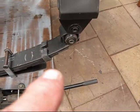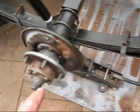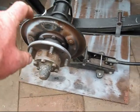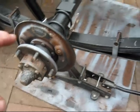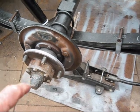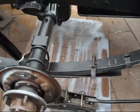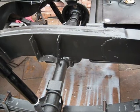I'm waiting for the shackle pins — for some unknown reason I haven't got two of them; I've got two of the others instead. Also I've got an oil leak on the stub axle here, so I've got to look at that — looks like I'll be checking off the hub and replacing the back seal, because when I tipped it up I got a bit of an oil patch on the floor. I tipped the axle up on its end because that's how I could pick it up and move it. It shouldn't leak anyway. So I'll do that, clean the disc off, and probably tomorrow do a bit of paint, put the brakes and everything else in, check around, and wait for the exhaust.